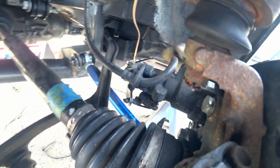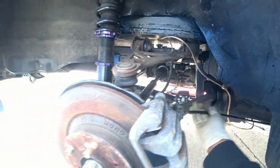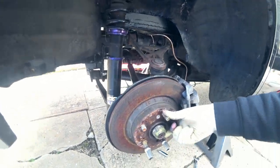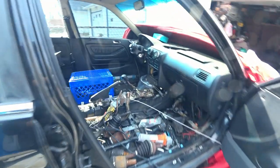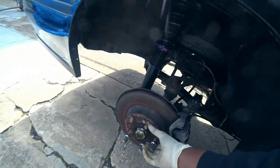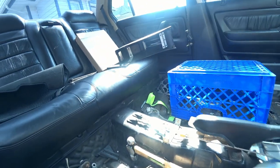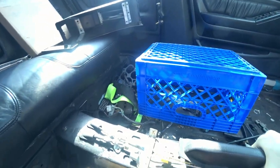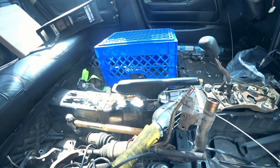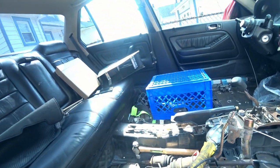There's that little clevis right here — pull back and the e-brake is engaged. Once everything's done, if I want to adjust it more I can, but the e-brake's still pretty firm. Release it and everything spins. There's still a little bit of adjusting to do — just gotta make sure everything's fine when it's actually rolling and it's not too tight. But for right now, that's the end of this project.